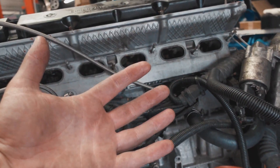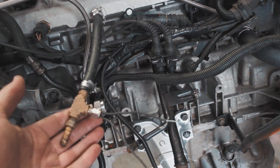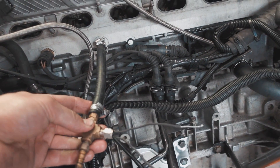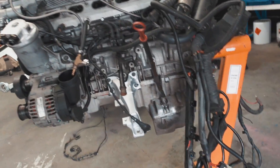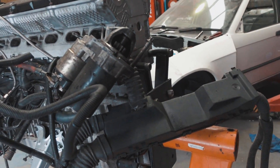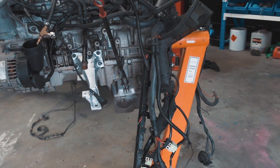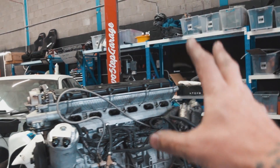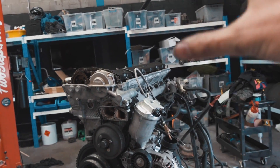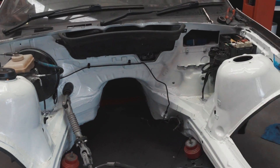On the motor side, I tied up and deleted a bunch of stuff in the engine loom. I fixed up a couple of wires on the inline engine temperature sensor for our digital dash with new heat shrink. I still need to tidy all of the loom here up but I'm not going to do that until it's in the car because I need to know lengths and make sure we don't cut stuff too short. The aim is to have this thing looking really minimalistic and super tidy so we're proud to pop the engine bay and have people look at it in the pits.